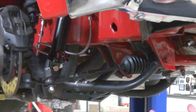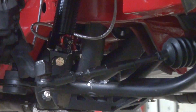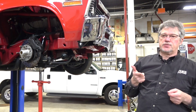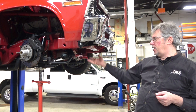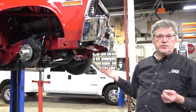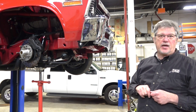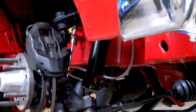Once that valve pack is installed, you're ready to make adjustments. What I did there is change the force curve from a standard force curve to our firm force curve. So when this car leaves the starting line and comes down from a wheelstand, it'll have more valving on the compression to help control it from bottoming out the front suspension or the oil pan. Quick-tune technology lets you do all this work right on the car. Obviously it could be done on the bench in a couple seconds, but in four or five minutes we can revalve the shock right on the car, ready to go to the track.